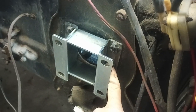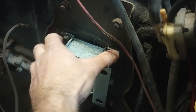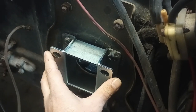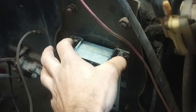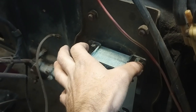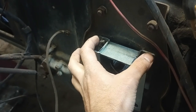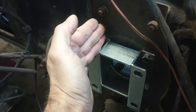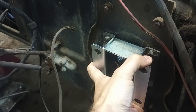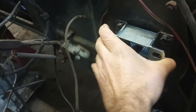I didn't want to make anything really undoable. And I did weld my bolts into the bracket, just because it makes it easier to hold it in place while you're bolting it in from the other side under the driver's seat. Word of caution: there's a little bit of wiggle room on the bolts — they're a little smaller than the holes. And once you weld them in place, you obviously lose that wiggle room, so if you're not lined up correctly it'll get a little tight. I did have one or two bolts out of alignment and had to hammer them a little bit one way or the other to get them to line up. So that was a little screw-up on my part. But it fits, it goes in — it's a little tight, but that's kind of good because it holds it in. It's not bolted in yet, it's just kind of resting there.